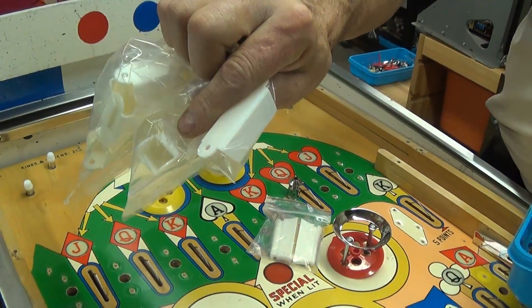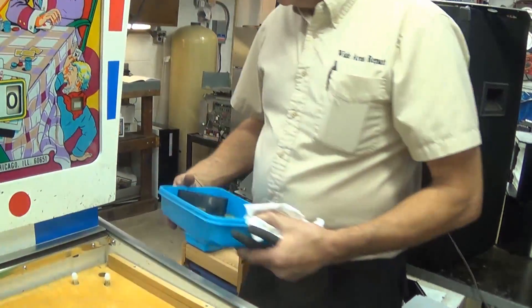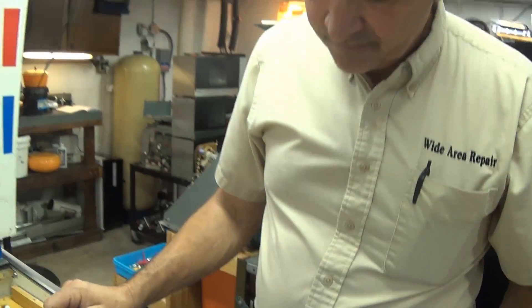You can see how thick they are — they're different, with rounded corners, not square — made for these old games. He makes them in different colors. Other than that you'd have to put on the dull, broken, cracked old originals where somebody over-tightened the screws and cracked the tops off. The factory used washer head screws — if you don't use those you'll break them again.